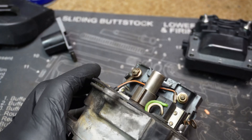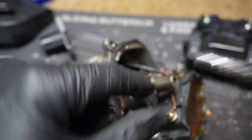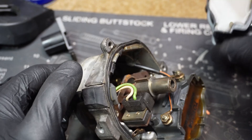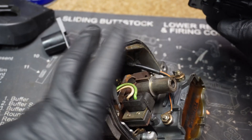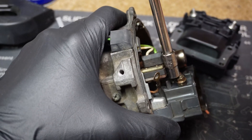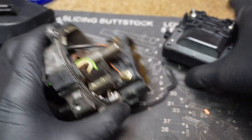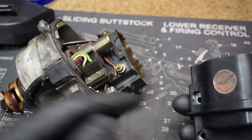To get this thing out you need an 8mm for the cap, a 12mm for the hold-down bolt, and a 7mm for the two nuts. I'm going to go ahead and replace the ignition coil but keep the old one in the glove box — one, this is a gambler car and it doesn't hurt to have a spare, and two, the coil is still good. OEM Toyota stuff is amazing, it lasts forever. On your new coil it will tell you positive and negative. I'll put a link in the description to a good coil — don't get a cheap one.